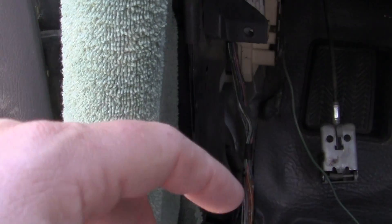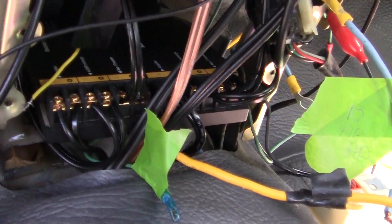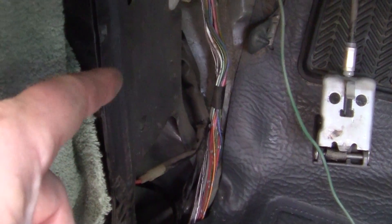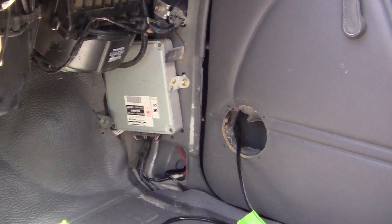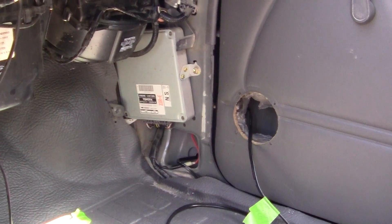The other left front will be a four-inch. There are the crossovers for it right there. The one on the left will have wires that go up underneath here, over here, over here. There will be a tweeter right down in here on the kick panel, and right here will be another four-inch speaker. I'll do the same thing on the other side, and what that will do is give me two really nice front right and left speakers.